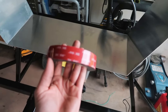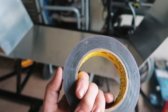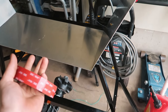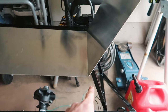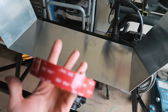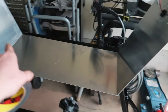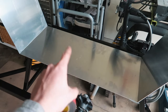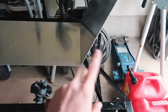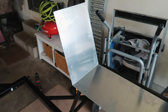What I'm going to be using is this 3M VHB tape. If you watch YouTube videos on this stuff, it's like a double-sided tape and it is crazy strong — I would have never thought I'd be using something like this to attach these fenders. Another good reason for doing this is that aluminum and steel in close contact can cause galvanic corrosion, so between the paint layers and this tape, we can avoid that. First I'm going to stick it on the fender, then flip it over, peel the other side, and use pliers to press it flat on there — because if it was all sticky at once I'd end up putting it on crooked.